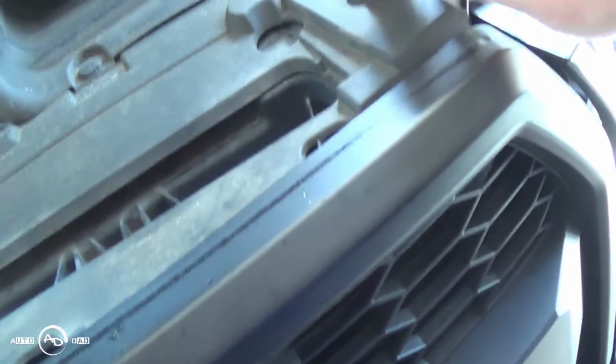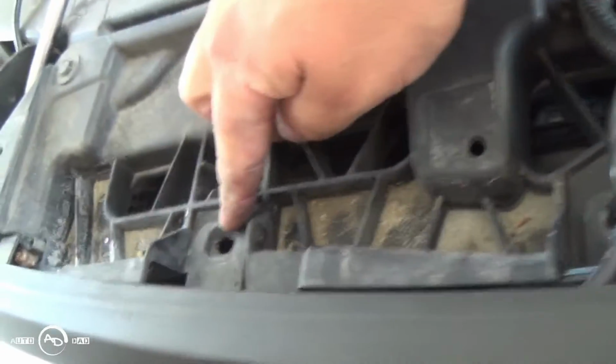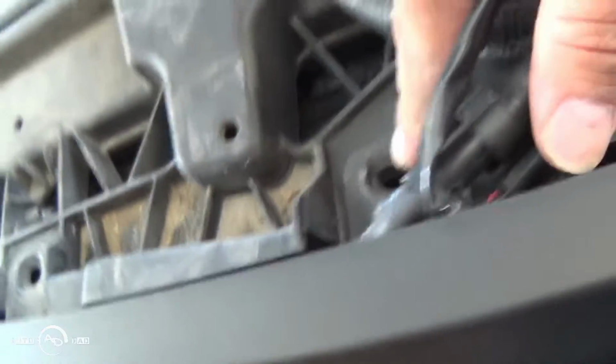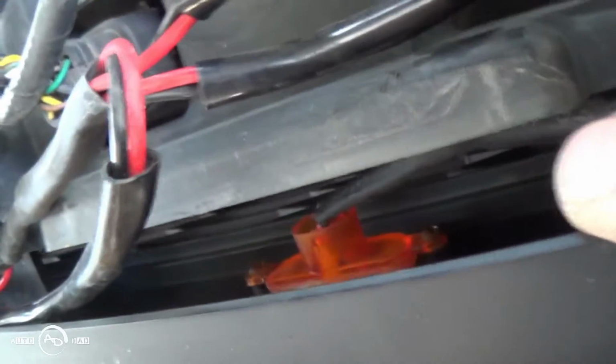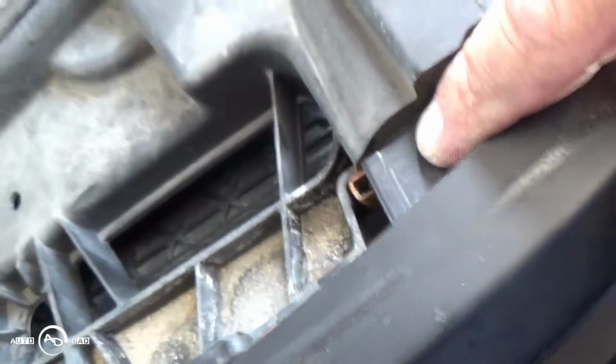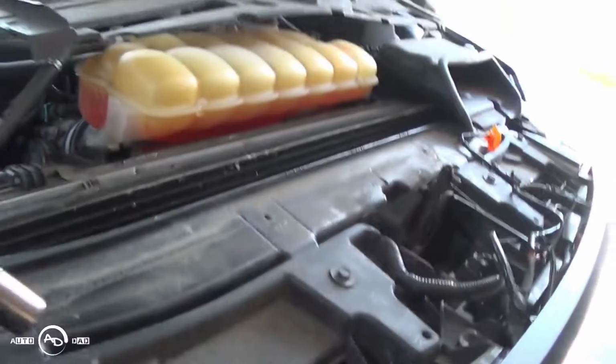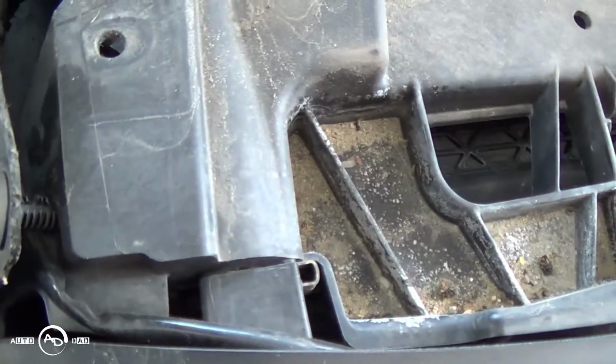First thing we got to do is pull these pins so I can get behind this dust shield here. Alright, I'll show you guys this real quick. So after you get the dust cover off, you got 4 more push tabs here. That allows a little bit of play here, but you still can't get in there. So you have a bolt on the 4 corners on this aftermarket grill, well, mine anyway. So one at the top here, take out, and then on the other side, this one here as well. And this is what I'm doing. Mine's a 14 millimeter, so I got a 14 millimeter on a 3/8 drive, swivel, extension, ratchet, and then I'm able to get in there and get that out of there.